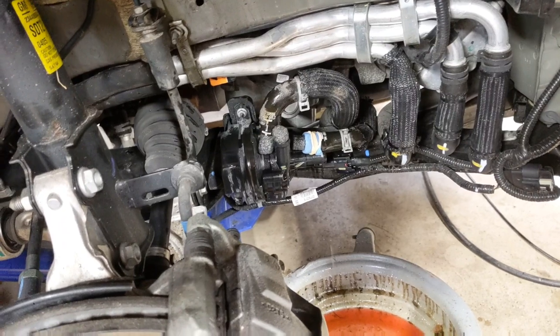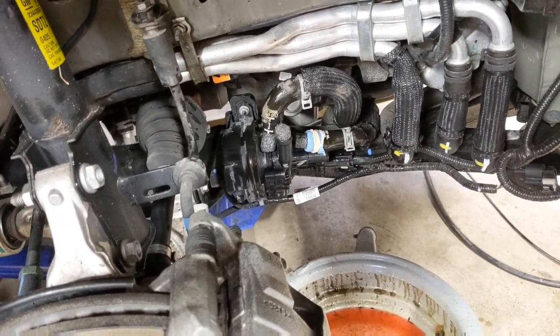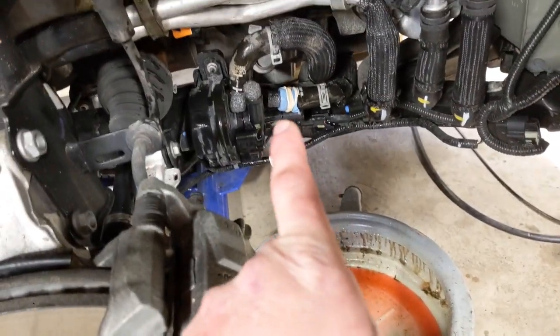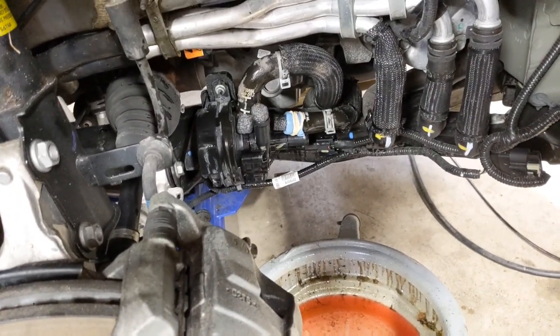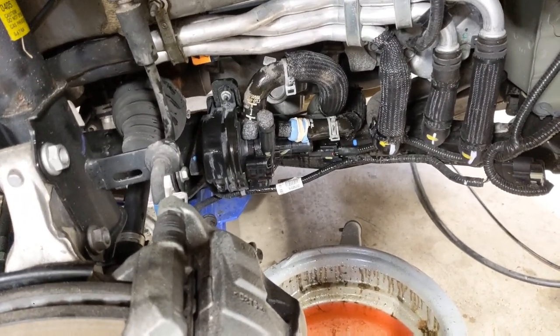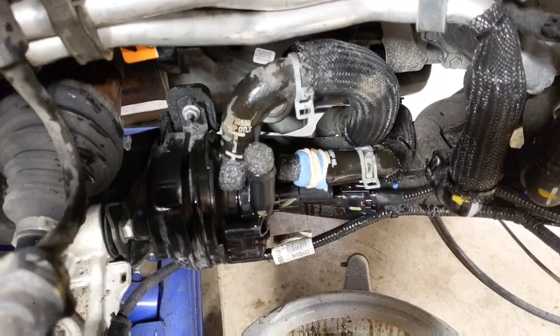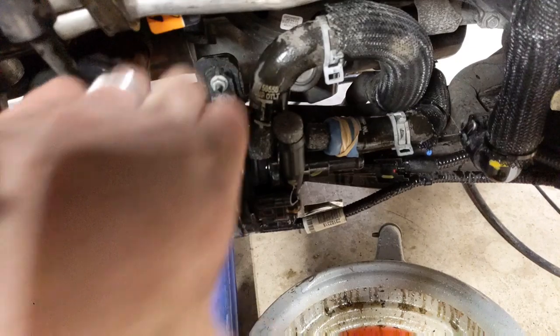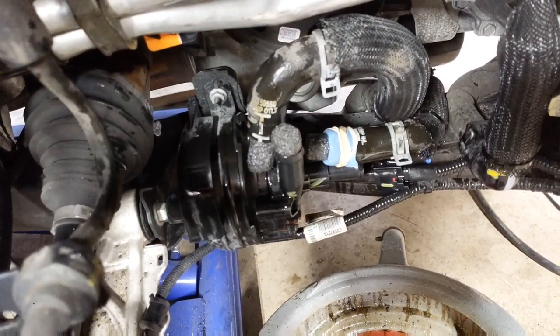Because this pump uses the same fluid that's in your radiator, you're going to want to drain your radiator — it's a good time to flush your coolant. I've already flushed the coolant, so I just plugged my lines when I pulled them off. But I highly recommend that if you're changing this pump out, you flush the coolant anyway. Now that the lines are off and removed, we're going to unbolt the pump and get the plug off the back side unplugged.